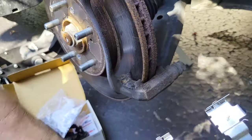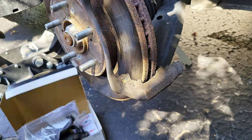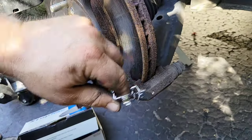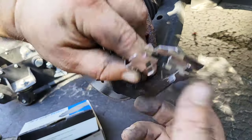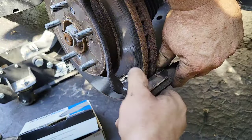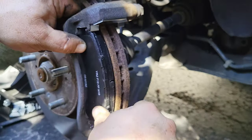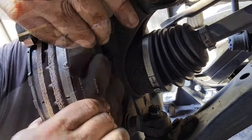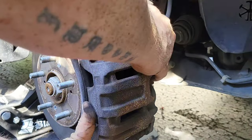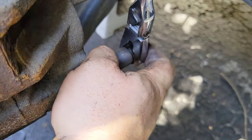Now that we're back here, go ahead and take our little caliper clips — I don't know what the hell they're called, shims maybe. Anyway, put it in there. You'll see these little ridges — it has a little ridge right here, and there's a little gap right there. That's where you want this to go. Push it down until it gets nice and flat like that. The brake pad will slide right on there. How loud is that lawnmower? It's like he's looking right at me. Slide that in right like so.